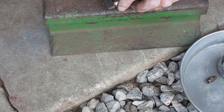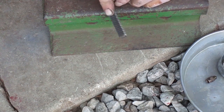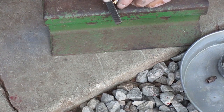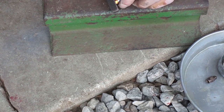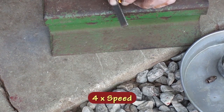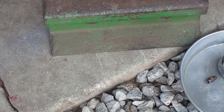Luckily I didn't move totally out of the camera frame. I'm going to have to watch that. You don't want to hold the file at a right angle from the part. If you look at the threads, they're on an angle, and you want to match that angle. You're filing the last thread into shape while letting the existing threads guide the file. Here's some bad camera work again.